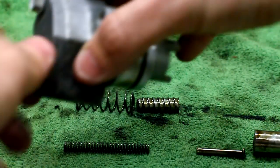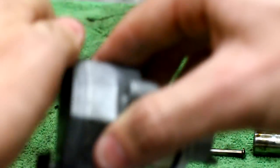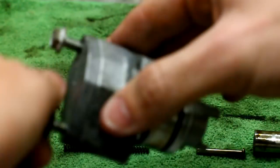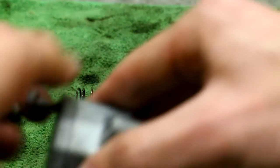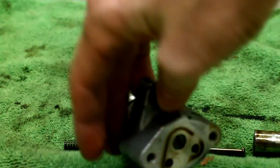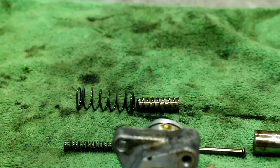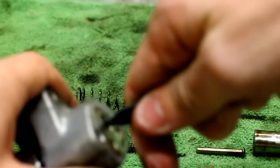When you're taking it apart, go ahead and take these two nuts off. It's pretty simple. Make sure you don't get these bolts mixed up with the ones that hold it to the car because they are different. This plate just pops off after that. You can see a little bit of oil under there — that's normal. And then the last part you'll want to take out is going to be this little screw right here. You just take it out with a standard flat head. It shouldn't be in there very tight.